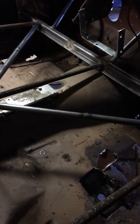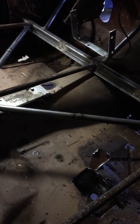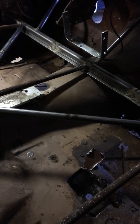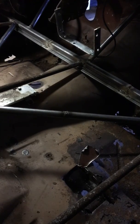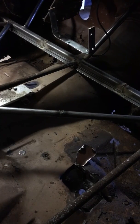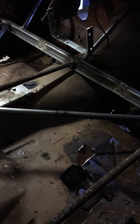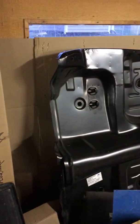But my concern is once I start working on those inner rockers that there's really nothing to hold this car up, and I don't have a rotisserie. So my thought is I'm going to go ahead and, like I said, run the jack stands up through the floor, then I'll cut the floor out around it, and just go from there. There's just so little left to this thing structurally that I'm basically starting from square one. Got the full floorboard over here, torque boxes, etc. all installed already, the braces.